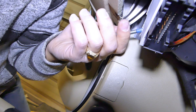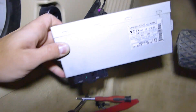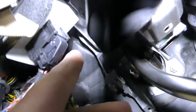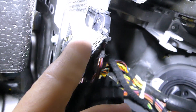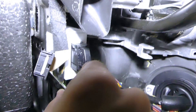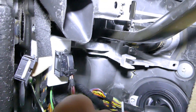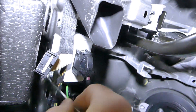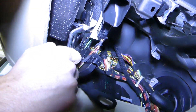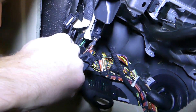You can see this is the bolt right here — pretty long bolt and it has thread locker as well. This is the immobilizer EWS CAS module. We can see the module is right here. We need to remove the CAS module, the immobilizer module, because underneath, right there, there is one bolt that we need to remove that holds it in place — it's under the other one. Otherwise we will not be able to remove it. This one I believe is 8 millimeter. An offset box wrench will probably work really good — you can see I have the offset box wrench here, 8 millimeter.